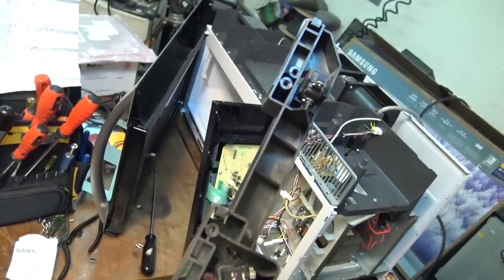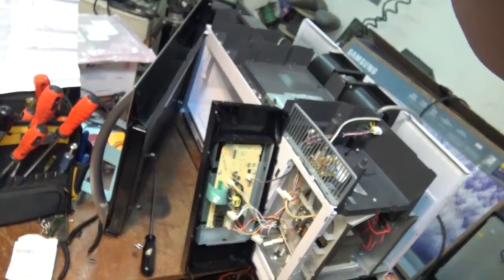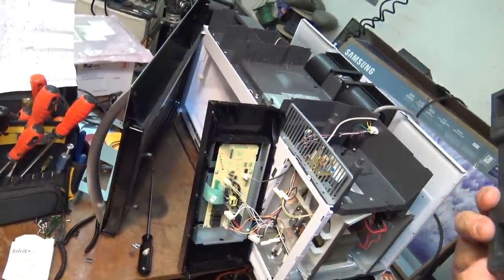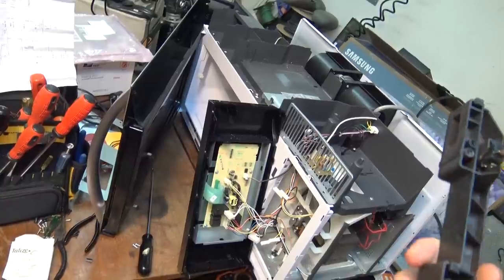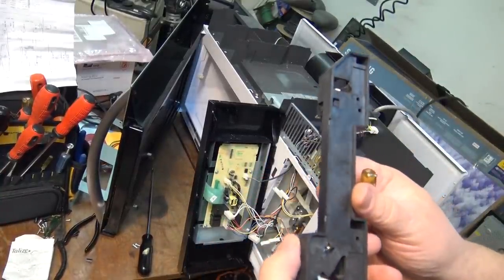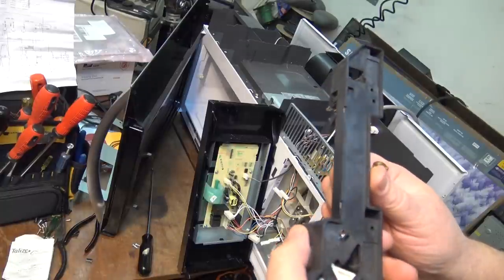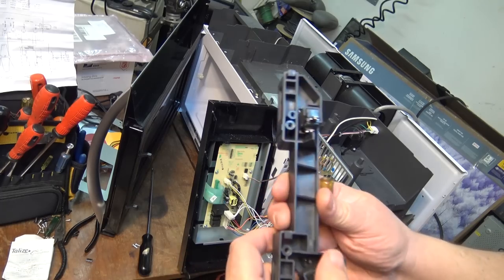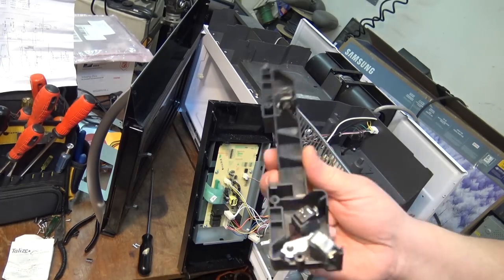The problem is this piece is worn — you can see a little groove right here. This is where the door catch goes in and latches. Because this is worn, there's a bit of play, so you can pull the door a bit and it will actually engage the monitor switch, which will put a short on the line before the primary switch opens. I'm probably not going to have much luck finding this part since it's a Kenmore and Sears is out of business.